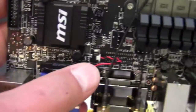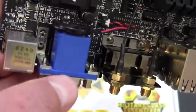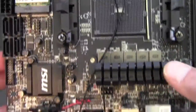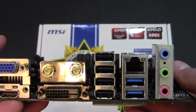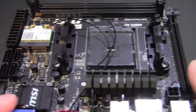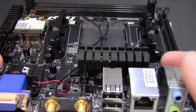You can see we have our battery plugged in and it's kind of stuck to the side of the D-sub port there. We've got another decent heatsink on the VRMs for the processor, and that should definitely help. It's not super tall so it doesn't get in the way of much, but it is there, and that is a welcome addition if you're going to use any kind of high-performance or overclocked APU or CPU.